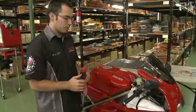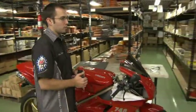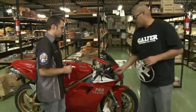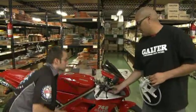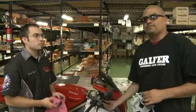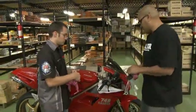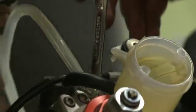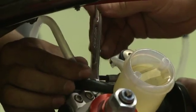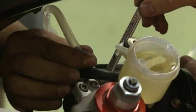Robert has the MightyVac, and we're going to start off with the master cylinder, since the master cylinder has the bleed nipple. We want to take out all the air trapped at the master cylinder first so we can get it working properly. We start off by putting the wrench over the bleed nipple, and then putting the MightyVac hose over top to create the suction and suck out the fluid we'll be pumping out.